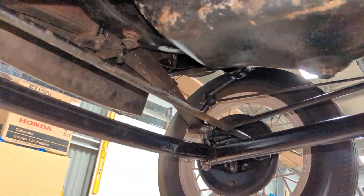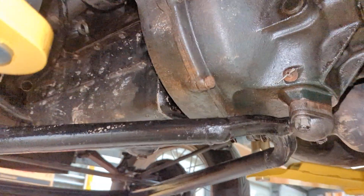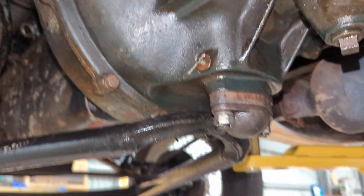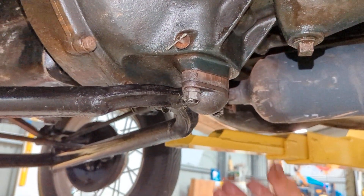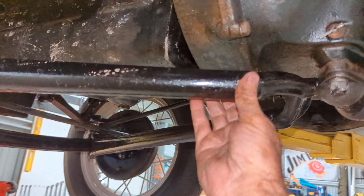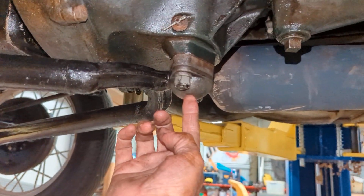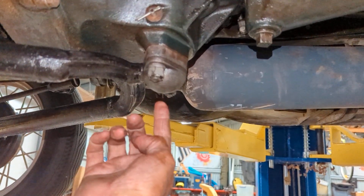Another thing that makes me think the cross member may be in the incorrect position is — despite the fact that it's a Model B engine and it's got floater motor mounts on it, which I know a lot of you guys hate, and it's also got a later model wishbone ball mount — when I have the wishbone disconnected and it's up on the hoist so the suspension is at full hang, the ball is about half an inch past where it's supposed to be.